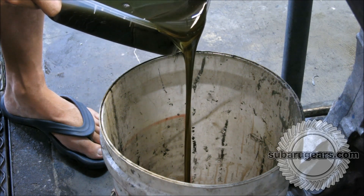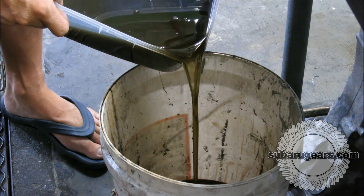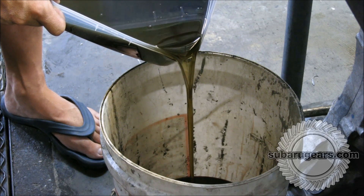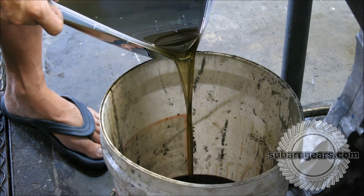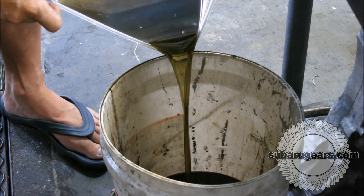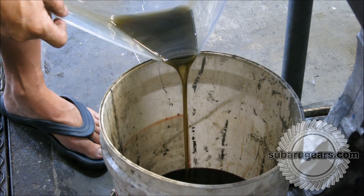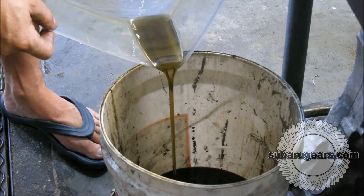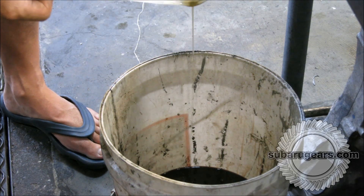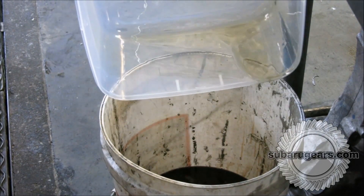As you can see, it strains pretty clearly. Obviously it's somewhat darker than when you first put fresh oil in, but just tipping it from the catch bucket into a larger bucket, it all seems to pour pretty smoothly and there's no pieces visible within the transmission oil or suspended in it. As we get to the bottom, it's always good to see whether there are silver slivers or grainy pieces. But as you can see, when I drain it slowly you can see that it's very clean oil with no sediment or pieces in it. Very well presented.